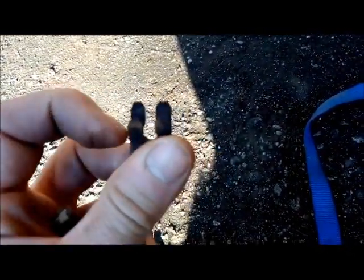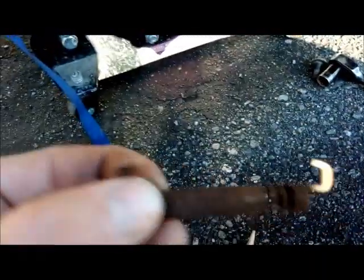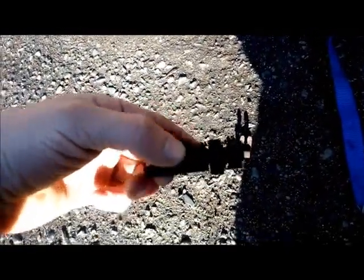Same thing with the ones on the bottom. It can be a little difficult, but I got both plates out on both sides. Here's the pin — it comes from the back with this pressure plate sitting on it, so you've got to just punch it down or up, whatever its orientation is on your vehicle. I then got the bottom spring out — just pinch it with some needle nose pliers and unhook it. Also the tensioner adjuster — that's just sitting on the bottom and pops right out.